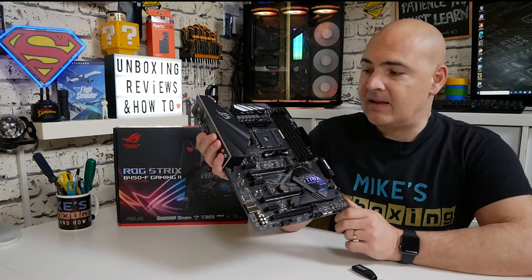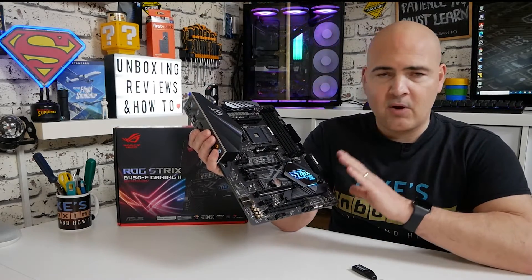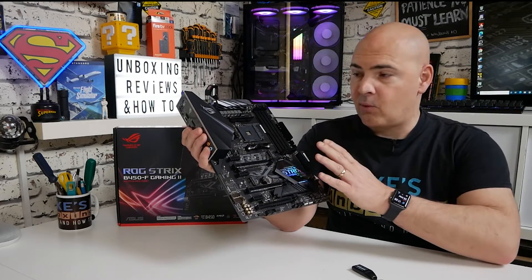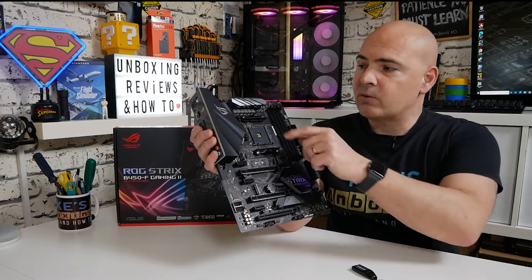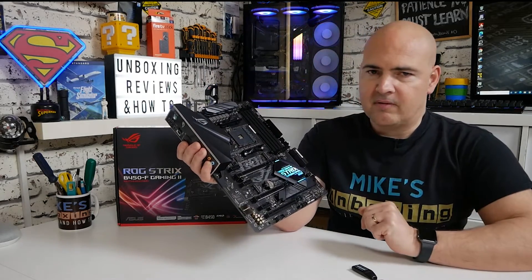The things you're going to need for this is a power supply for the motherboard. You don't need a processor, you don't need RAM, you don't need any storage — literally all you need is the bare board itself and the power supply to power the board. It doesn't have to be an expensive power supply, as long as it's got the 24-pin power connector for the board and also either a four or eight-pin connector for the top corner.